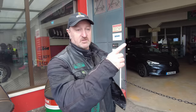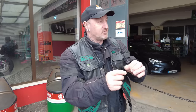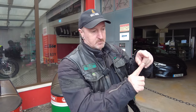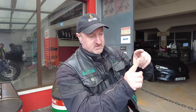Right, this Honda dealership have now ordered the grommet that goes on the end of the shaft. It's like a little plastic rubber button. It's actually called a push rod, but in effect it's like a tiny little round grommet. Piece of plastic, basically. It sits on the end of the cam chain tensioner. There's a hydraulic cam chain tensioner, and it wears out, which lets the cam chain tensioner slacken off. They've ordered one for us for €3 something. Their labor rate is only 30 something euros an hour, which is cheap. So we've ordered it. It'll be here Thursday.